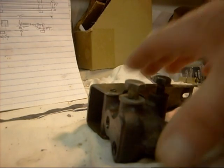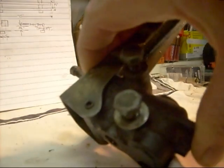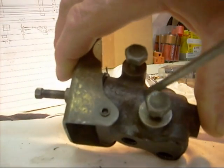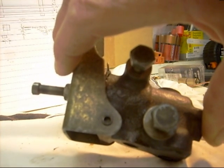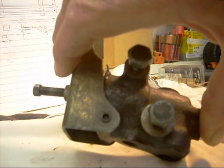Two bolts attach the tandem cylinder to the chassis, and this part is attached to a spring. It's supposed to be set at approximately seven and three-quarter inches. When you put the brakes on, the body moves and adjusts it maybe an eighth of an inch. I bypassed that and sure enough the brakes work fine without it — what a wonderful design. The handbrake also didn't work, so I took the wheel off and adjusted it. Now we have a full braking system.